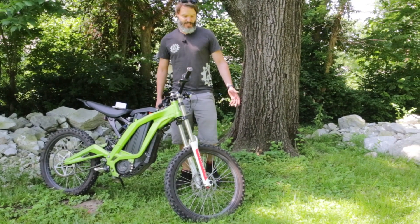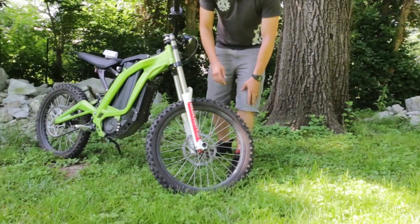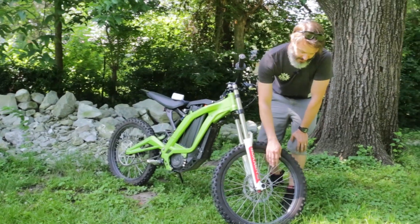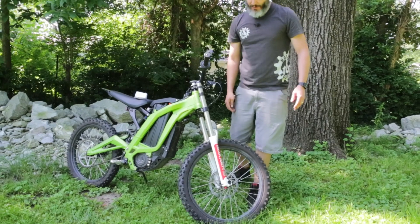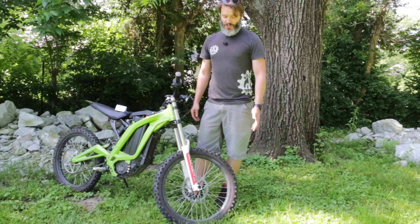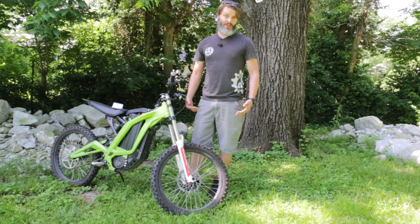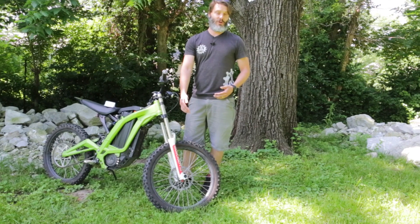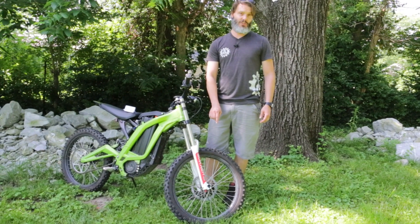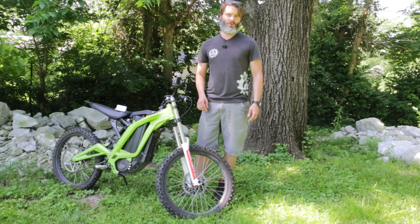The first thing I mentioned in the original video was that I was concerned about the front hub — stress cracking over time — because it has 12-gauge spokes and just a normal flange width, about 2.6 millimeter. But a few factors have contributed to this actually being a really solid front wheel over time. I've jumped this thing downstairs and done things I probably shouldn't be doing, and I've had zero problems. The spokes are long enough at 12-gauge that they have enough stretch — the longer the spoke, the more stretch you get. The wheels I had problems with before had shorter spokes because they were 16 and 17-inch wheels. These are 19-inch, so we get more stretch, which is good for the hub.